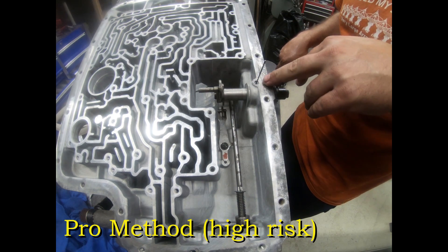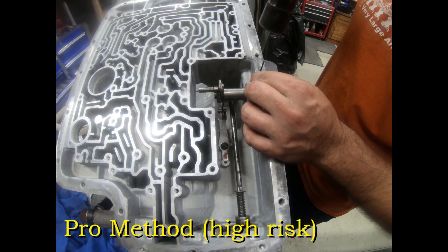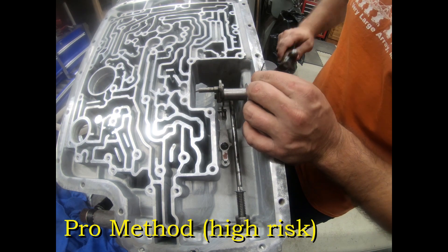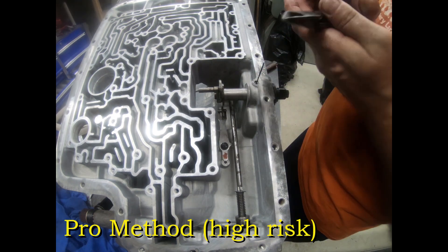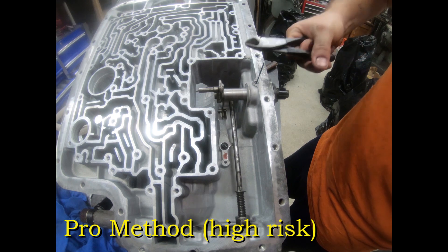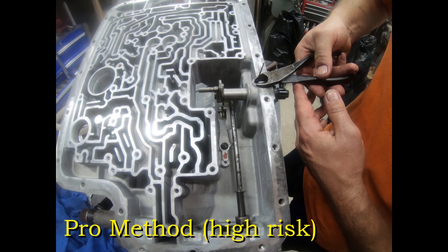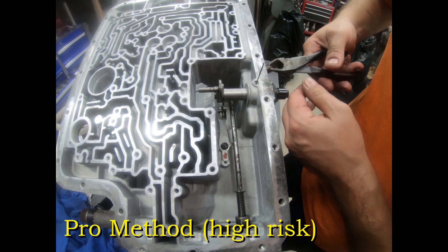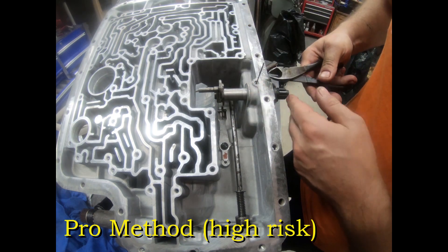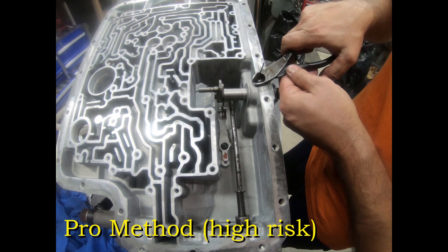The roll pin can go below this upper surface, so it'll first do that. Then you take diagonal cutters, grab the drill bit, and pry off of the side of the case a little bit at a time. Readjust, because you want to pull this as vertically as you can. If you crack the drill bit, you won't be able to get another one in there and you'll have to go back to the screwdriver method.